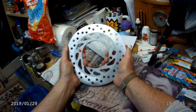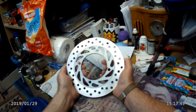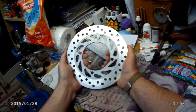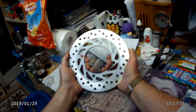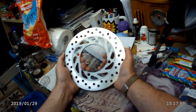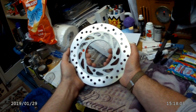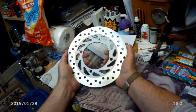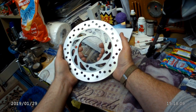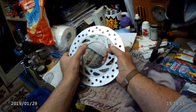Have you had experience of Chinese brake discs? How much were proper ones? EBCs were about £80. And if I went to a Honda dealer and said I want a Honda supply-by-Honda disc, I bet you'd be talking £180, if not more. But what's the minimum thickness — 4.5mm. LYZ — is that made by LYZ in China?